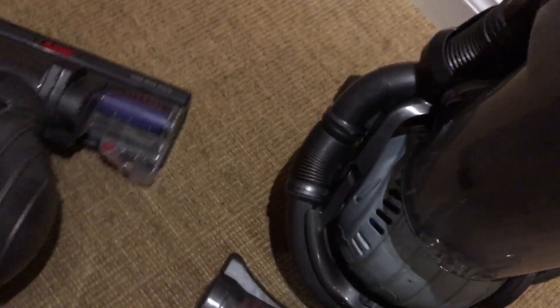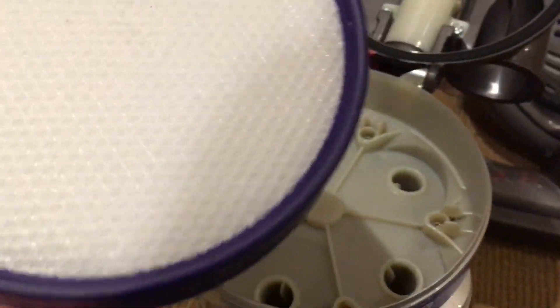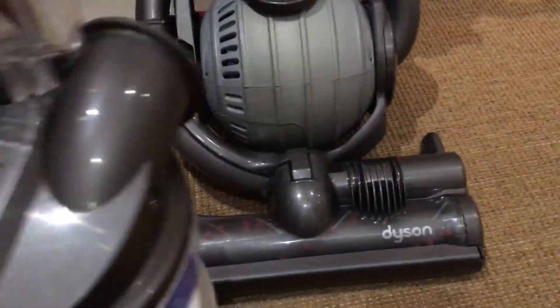I don't really want to show them working because they're all clean and they just sound like normal Dysons. These two I did fully strip and wash. The hose is still slightly damp on this one. They've got quite a lot of scuffing - I've tried to clean some of it up but it's all clean inside now. New filters in both. New brush roll and a new brush roll end cap, which has made all the difference to how they sound - that's the same for both. Both have new seals as the old ones had perished away. Cables cleaned, tools included.